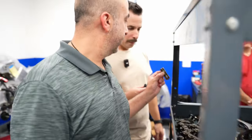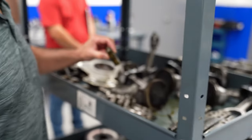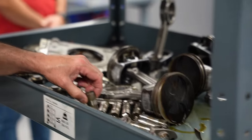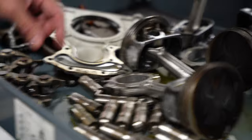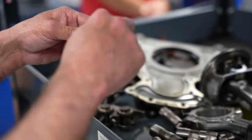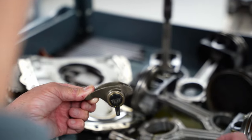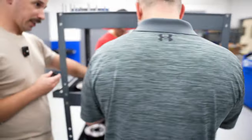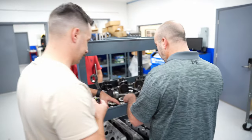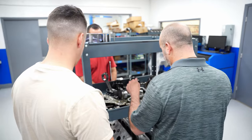You don't think that's because they might have — I always forget the name — the preload? You don't think it's because they just wanted that with a gun, pop pop pop pop, and didn't check top dead center or anything? Because the preload is just set by this — you can't bottom this out. This doesn't have adjustment. This is just straight on and that's it. So these are some of my factory LS7 rockers. These have the trunion upgrades in them, and then there's another set that don't. That's why I put on the list — we need about three or four that I can do the upgrade for.